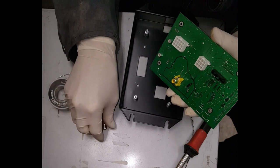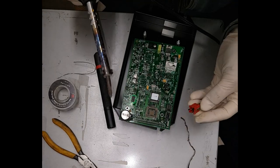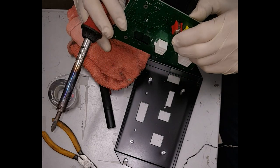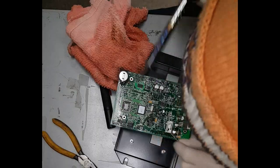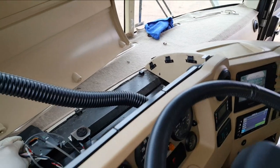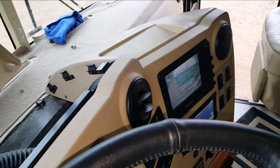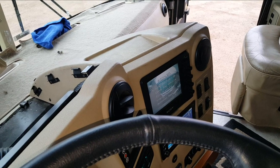I think I already forgot how this all goes back together — luckily I didn't take that one apart. I don't think I got anything wrong this time. I wish you could see this a little bit better but I can't show you both things I'm doing. I am wiggling it — and the screen's not jiggling anymore. So it does seem like it helped out quite a bit: reflowing and polishing up that center contact. It's definitely not how it used to be.